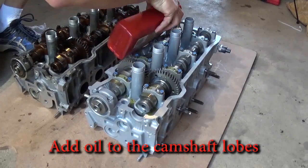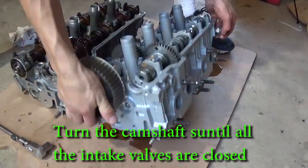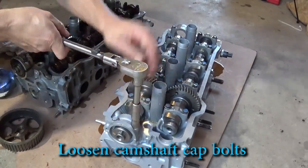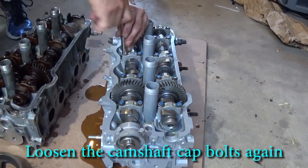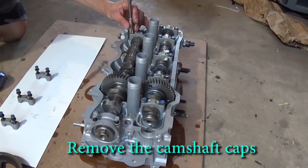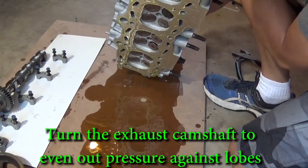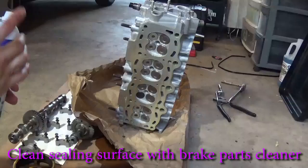I'm going to put a little bit of oil on the camshaft because I'm going to turn these camshafts. Put the pulley on and turn the intake camshaft to where all the valves are closed, reducing the pressure on the camshaft. This is so I can take the camshaft out without damaging it — remember the head bolts are hidden under the camshaft. Loosen the caps a little bit at a time. Notice this one came with the timing gears marked — that's great. Carefully take all the camshaft caps off and keep track of their positions. I'm also going to turn the exhaust camshaft a little bit to even out the pressure on the lobes. Just loosen the caps a little bit at a time and pull that exhaust camshaft out. Let's get all that extra oil off of here.